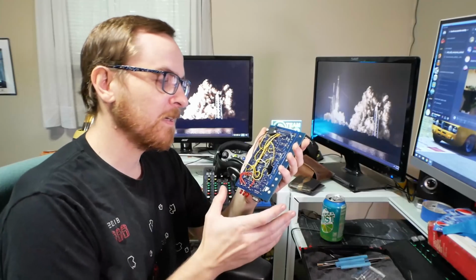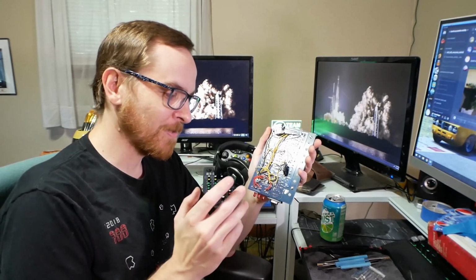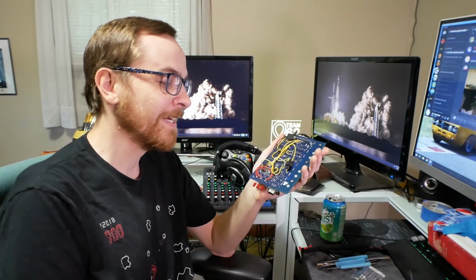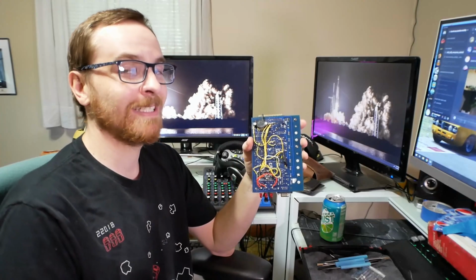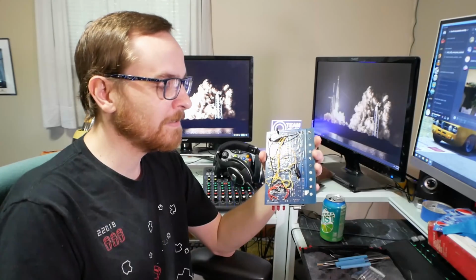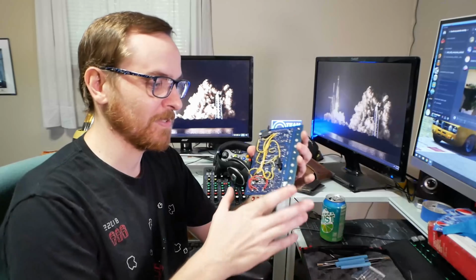You know, I'd almost started to miss spending quality time with my little circuit board here. Turned out that through our investigations last night, some mysteries were uncovered with this board. The current setup is actually for an optical sensor. That is essentially what a cam angle sensor would have been, and it is set up completely in a way that the optical sensor would be enabled. We don't have one of those. We talked about that last time. I don't currently have a setup for a cam angle sensor, and it was running off of a VR sensor. The difference, basically, the VR is the magnetic pulses, and an optical sensor is, well, just what it sounds like.